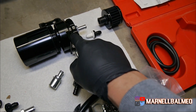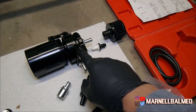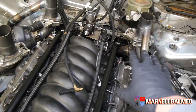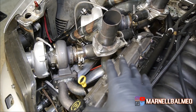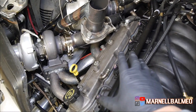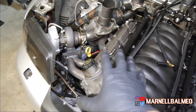If there is more pressure, the backup valve will allow it to vent one way so air isn't bypassing the valve cover suction. This valve cover already has the fitting in place, so that takes care of one side. The passenger side is going to be a bit tricky — by the end of this video I'll figure it out. I could put a filter there and let air flow that way, or connect it to the turbo inlet up front to create a little more vacuum under boost.